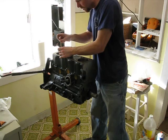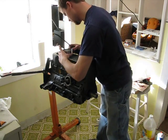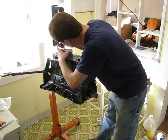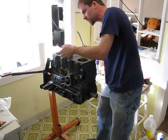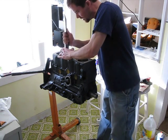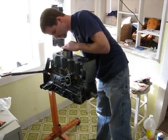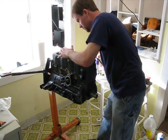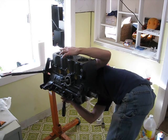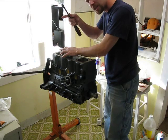I'm trying to take you just a smidge more because I don't want you to try and poke out a ring on me. Okay, now I've got you in there and you're right about where I want you. Make sure all your edges are equal here — tap the edge while you've still got it a little bit loose, that way you don't have an oil control ring that tends to slide out on that side. And very slowly I'll press it down. One thing you will have to do when you're doing the top two — you'll actually have to move the connecting rod over. When you see how it started getting hard, it was actually just a little bit farther over and it hit.